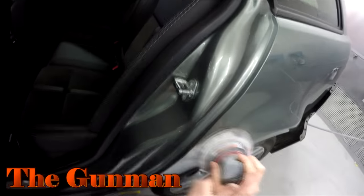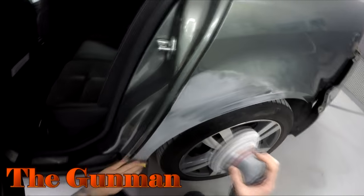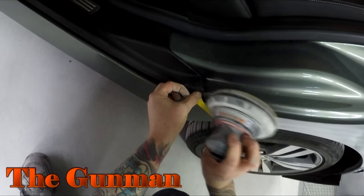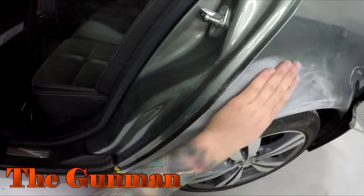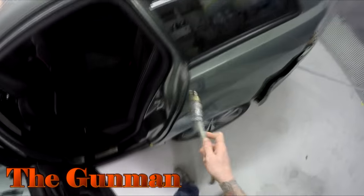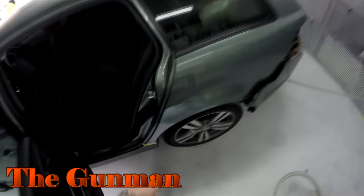You've noticed I put a little bit of tape down the bottom where that sill cover meets the quarter panel, just so I don't hit it when I'm doing the prep work. When you're doing this you probably should put a piece of paper over that door opening so you don't get too much dust inside the owner's car. On this occasion I decided not to — there were really only two tiny little bits I needed to give a very quick sand. But if it had been a bigger area I probably would have covered it up.